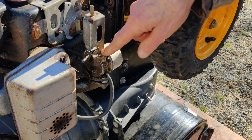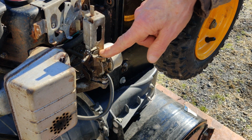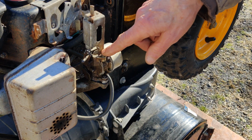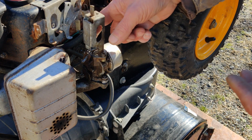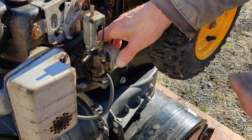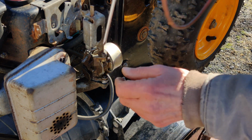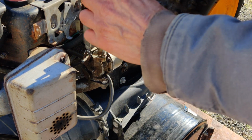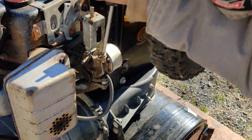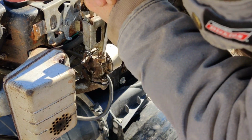The best way, sometimes these are Phillips head bolts, and sometimes they're really hard to get off. So I know these will come off easy because I had them off already. I usually loosen these bolts and take them out first because the carburetor's anchored on there, and that works out a lot better for me anyway. So we'll begin by taking these off. And it's a number 2 Phillips head. Oh boy, even though I had these off already. Oh, there it goes.